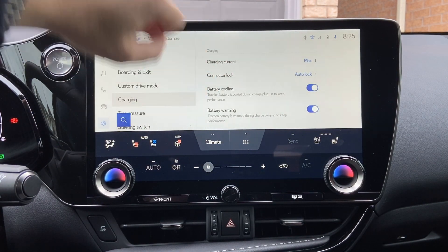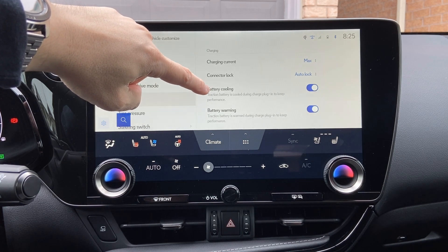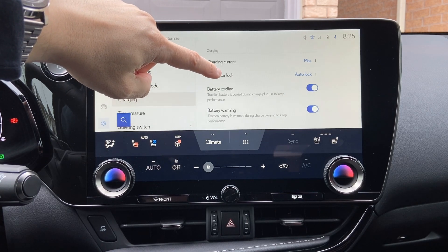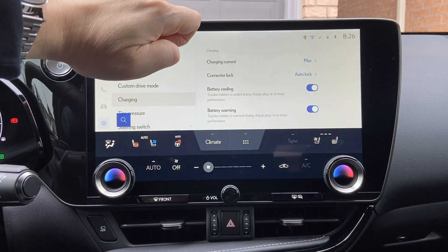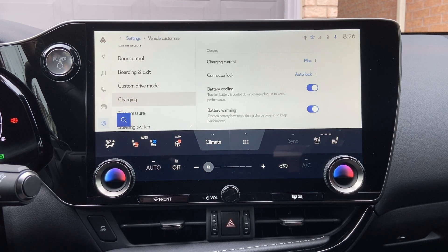The last two options are Battery Cooling and Battery Warming. Battery Cooling is used when it's hot outside — in summer months or after driving a lot — and will use the AC to cool down the battery packs before charging begins, maintaining optimal charging performance. Battery Warming is the opposite: in cold winter conditions, it's harder for the vehicle to charge, so the system warms up the batteries first to achieve the most optimal charging. One important note: battery cooling will not operate when your charging voltage is only 120 volts.